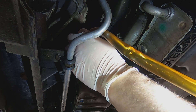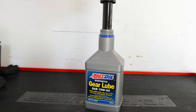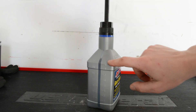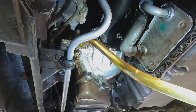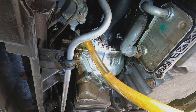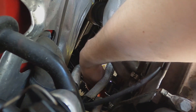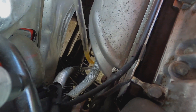As for refilling, there are a couple different ways to do it. You could measure out exactly what you need to put in, but then you have to make sure you suck all of it up and get everything out of the line and the pump itself. What I did was connect my pump to a full bottle, pumped out three-quarters of a liter for the angle gear or just over one for the rear diff, pumped that until it came out of the bottle, then removed the pump from the bottle and pumped out the remaining fluid. Neither the angle gear nor the rear diff has leaked or made noise, so I'd say the fluid level's good in both. If you've got a better method, definitely leave a comment. One last thing about refilling the angle gear — if you wanted, you could go in from the top, but you would need a second person to hold the hose in the angle gear. You can fit a hose between the engine and the firewall, but I wouldn't trust this without someone making sure the hose doesn't fall out and dump your new fluid all over the ground.